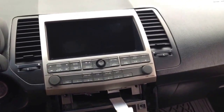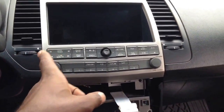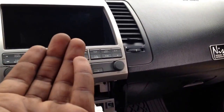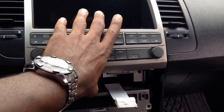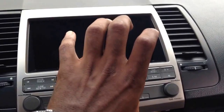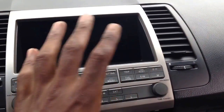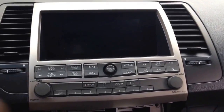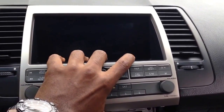I'm gonna put the gold one all the way to the right so I know that's the upper. Now here's the kicker with your top bezel unit that's connected to your vents — it has a hook on the back up here. So when you remove it, you don't pull it straight out. You grasp it right here in the middle and you pull UP, not out — because pulling out is going to break the tabs up here that secure the navigation bezel into place.